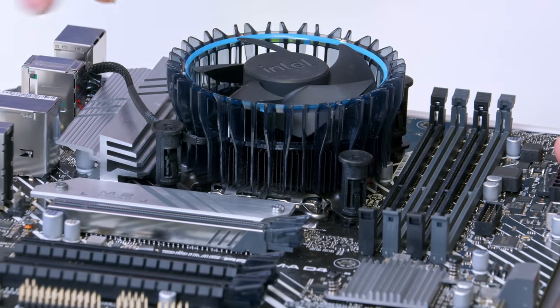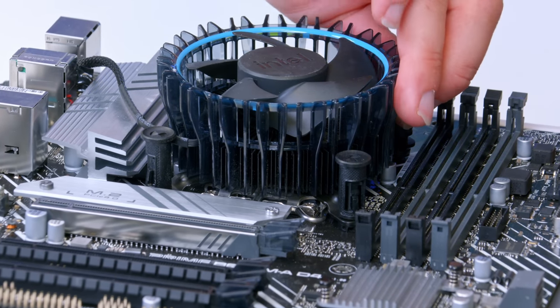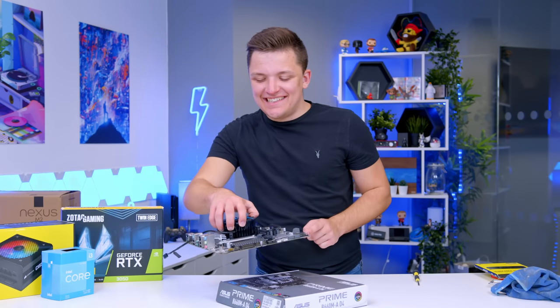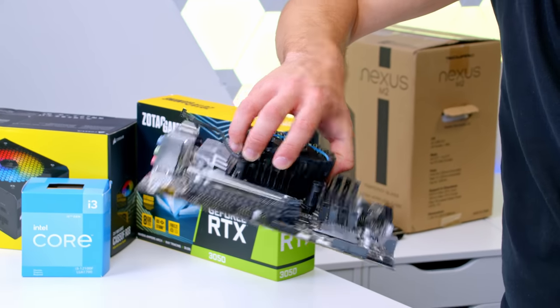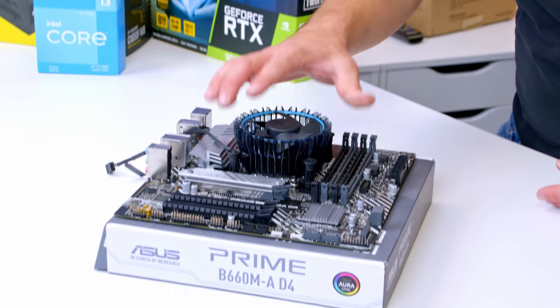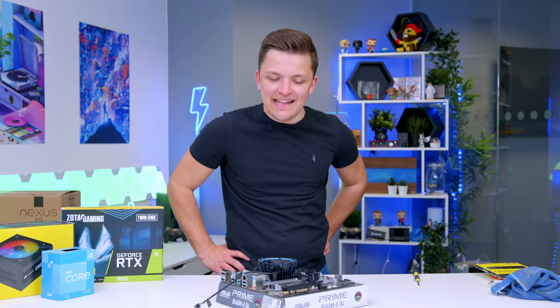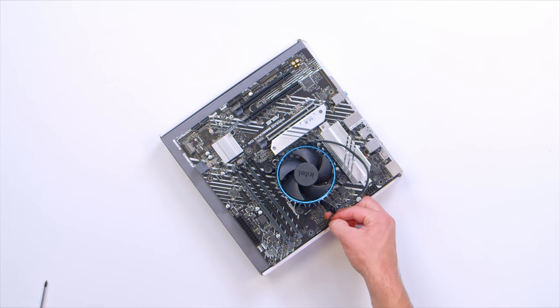Click it in corner by corner, straight through the four holes on your motherboard, and that's basically it. Intel make this super simple and great for a first-time builder. A good but slightly scary test to make sure it's on okay is to pick the cooler up, and if the motherboard comes with it, you know you're good. Give it a bit of a wiggle and you're all good to go. For those saying this is a very dangerous thing to do — so is installing your motherboard with a cooler that's going to fall off later, once a graphics card and other pricey components have joined the party.